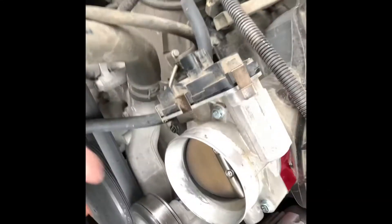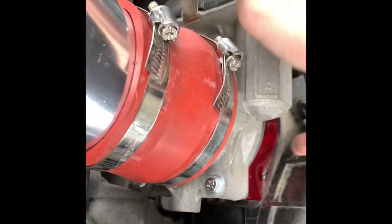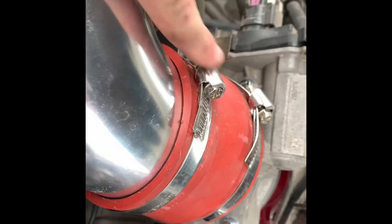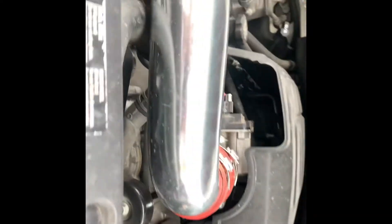What I'm going to do now is put my intake back on, tighten down my clamps, recheck my four bolts, and hook up my throttle body again. The throttle body spacer is here, with the gasket in between the throttle body spacer and the throttle body itself. Connecting my throttle body back — got my clamps all done. I do need to replace these clamps, they're a little messed up, but it's all tight. Got my vacuum hose hooked up and I'm going to make sure my sensor is back in. Tighten all my clamps down here.